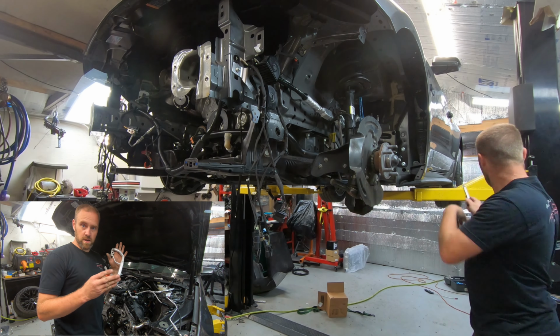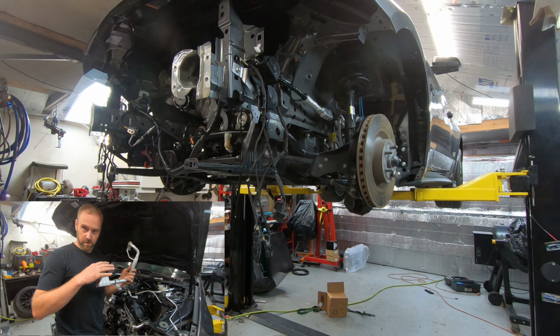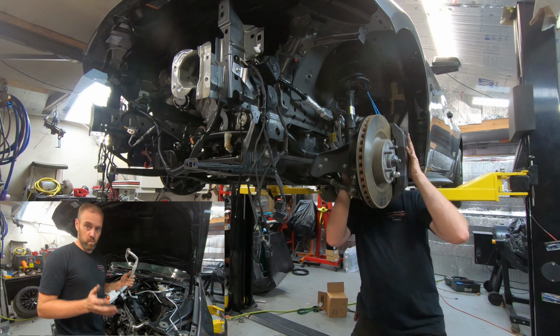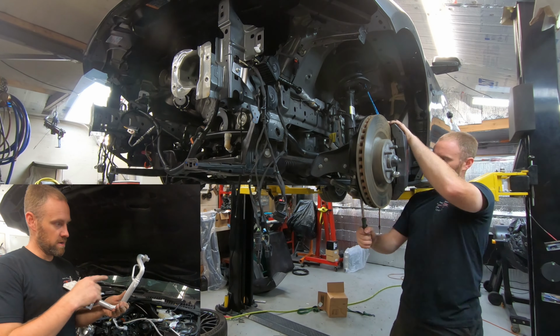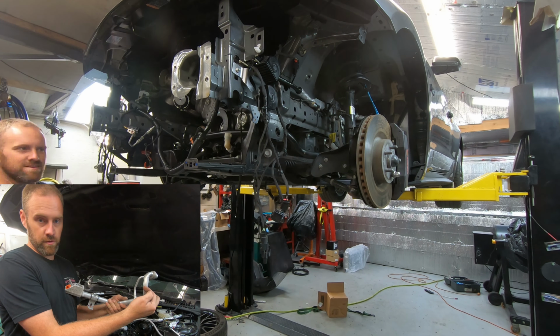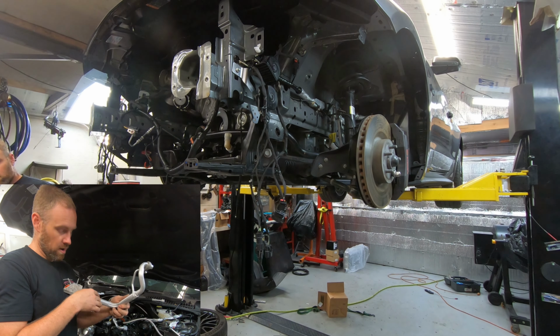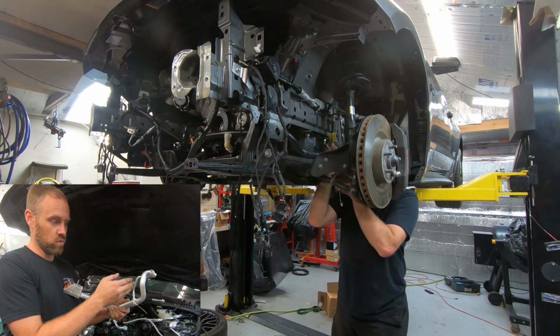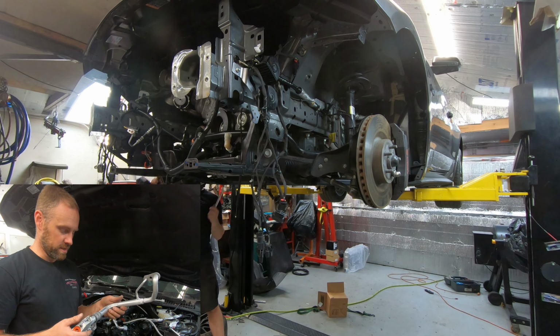Alright, so here is the 1234yf pipe. It is basically the only difference in the entire system from 1234yf and 134A is that it's more efficient because this guy here, you have your low side and your high side. So this is the outlet for the low side. So this is the cold end going here, and then the high side actually goes around that cold side, so it actually cools down the high side even more than it already was. So it makes it more efficient, essentially.